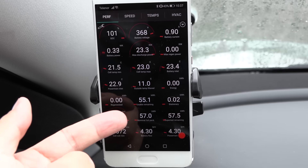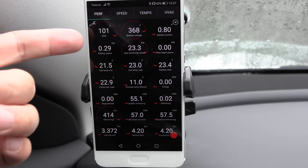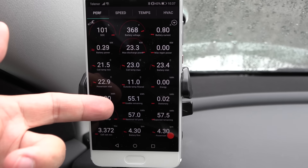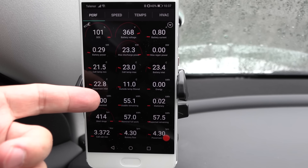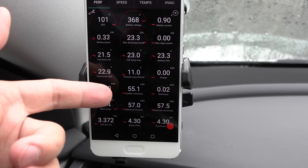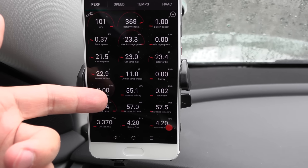Wait, I just noticed — it's not this number we look at. It's this: user remaining is 55.1 kilowatt hour. But we are at 101 percent. Is this an older variant with less energy available? I don't think so. SR Plus 60 kilowatt has been unchanged for a long time. But we have normal and full pack at 57 kilowatt. Based on what I know now, we should get around 54.5 kilowatt hour after losses. Let's find out.